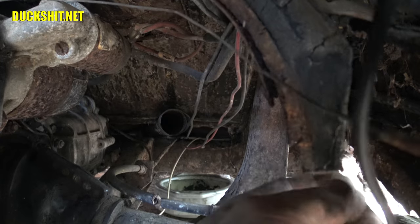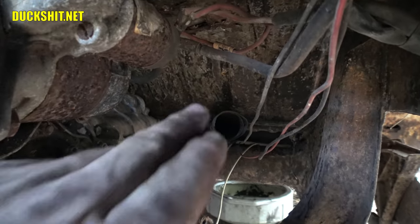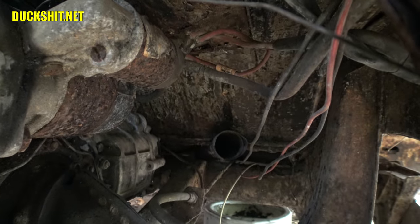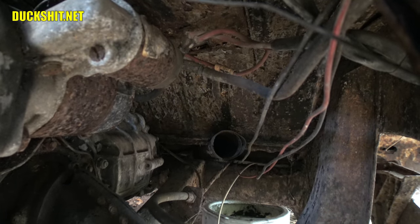All right, there's only one thing we need to detach after that, and you're looking at it, it's the wires to the starter. Remove all of them. I believe it's a 13 millimeter wrench, ought to get them off. So we'll get up underneath there and pull those next.